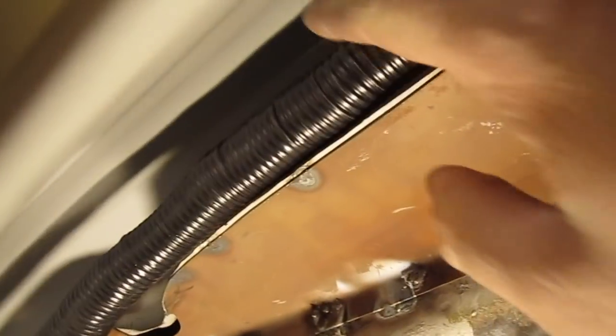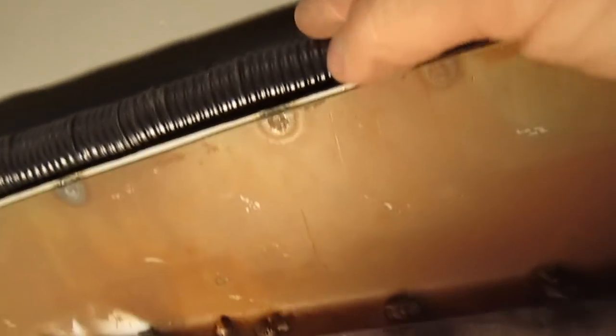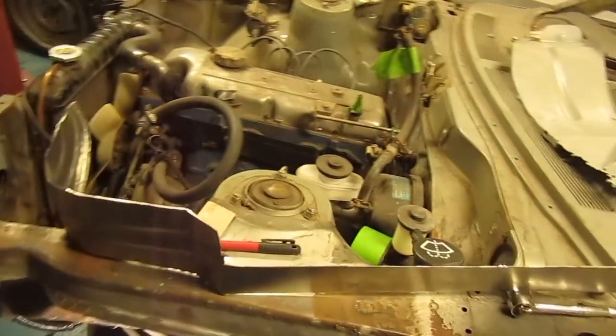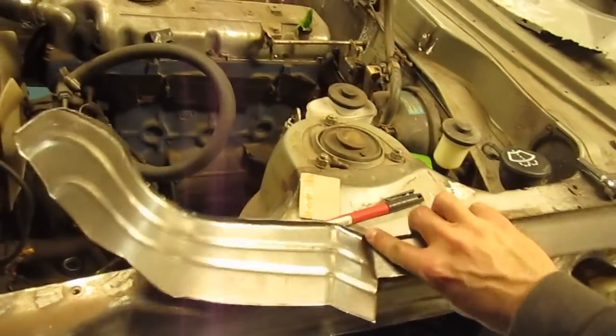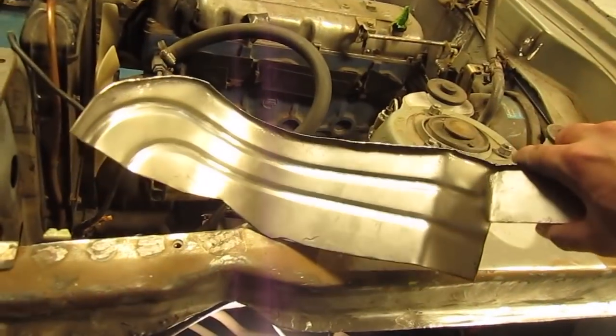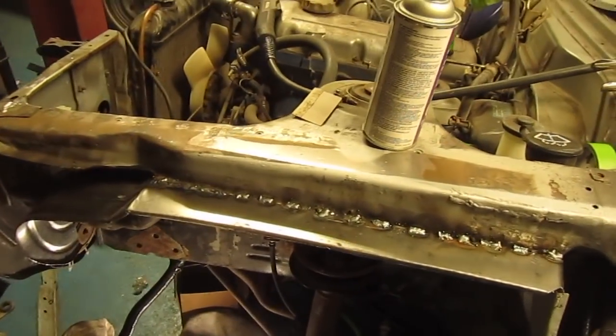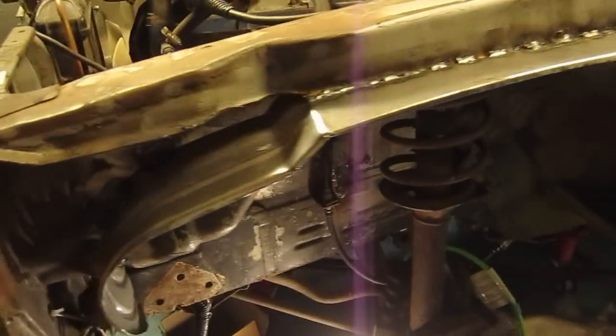Looking up into the top of the wheel well here on the driver's side front — there's my wiring. It'll be tucked in yet, but if you look at it, the stones are directly going to hit it. What I'm going to do is build a metal plate that I'm going to weld in place there to keep the stones directly off of it. This is the part that I have made to cover the wiring harness in the wheel well — got a couple bead rolls in there and then kind of rolled the edge. Here's my wire cover — protection against the rocks.